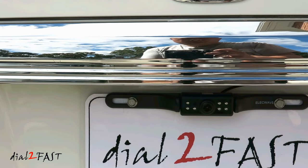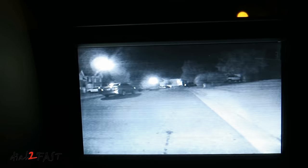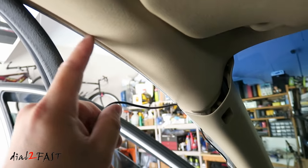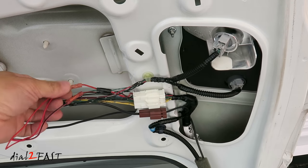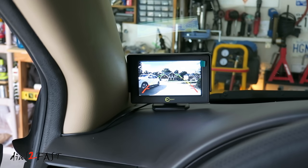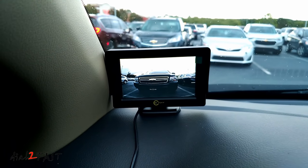As you can see, this backup camera system worked very well. The ElecWave backup camera provides a very clear image for both daytime and nighttime. During the daytime it has very good contrast and exposure, and at night when it's completely dark the infrared LEDs will turn on automatically and switch to a black and white image with good night vision capability. As for the installation, you'll need to run the video cable from the front of the vehicle to the back. The front LCD monitor has a ground wire you need to connect to chassis ground, and the positive wire will be connected to the red wire on the video cable running to the back. As for the rear camera, you only need to connect the positive wire and also connect it to the red wire on the video cable. By doing this, whenever you have the car in reverse, both the backup camera and the front monitor will turn on. Some people might want to connect it to a toggle switch to manually turn on and off, but what I showed you is how to connect it if you want to use this as a backup camera system.